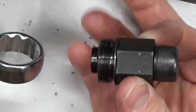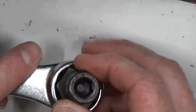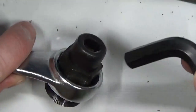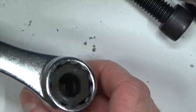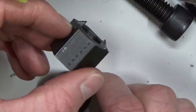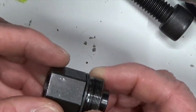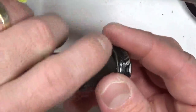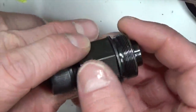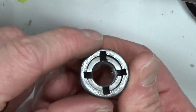Now we need to separate the mag plug from the follower nut tool. Take your 7/8-inch crescent wrench and locate it on the nut, then take your 3/8-inch allen key and twist them in opposite directions to unthread that bolt. The bolt comes out, and there's the follower nut tool. You can see how the tool locates inside those notches and the bolt locates against the plug — it's one big universal rotation, giving you a lot of grip and surface area to wrench on, whereas before you'd be trying to use a flathead screwdriver.